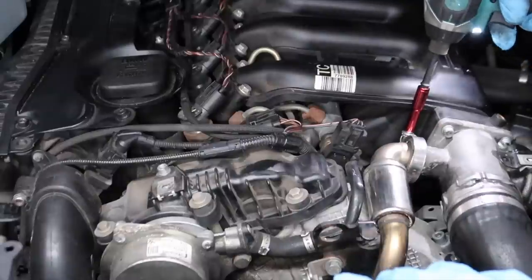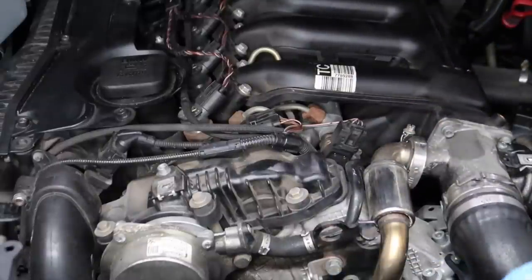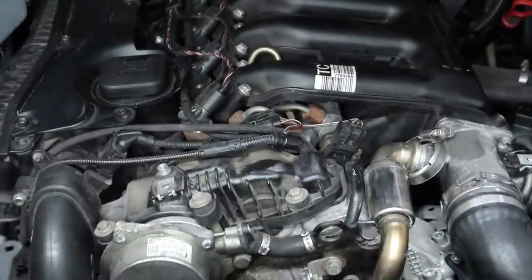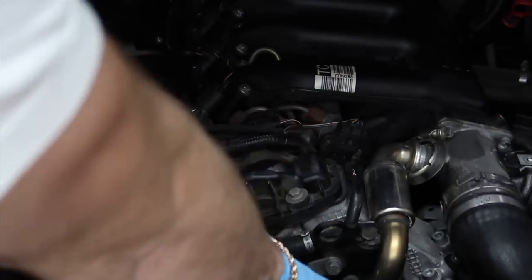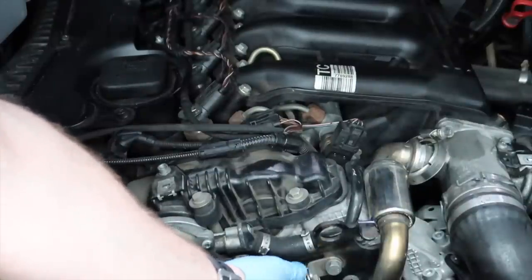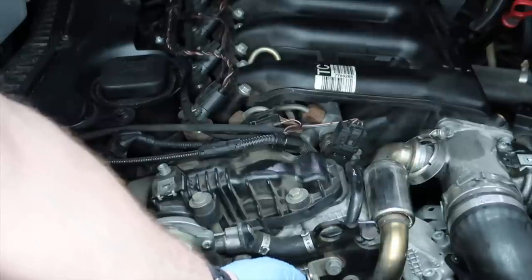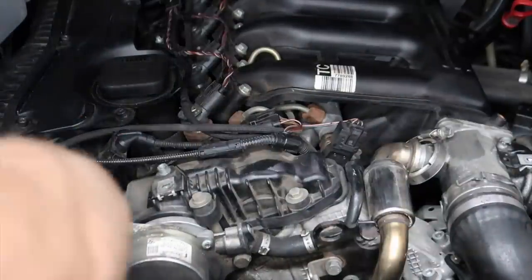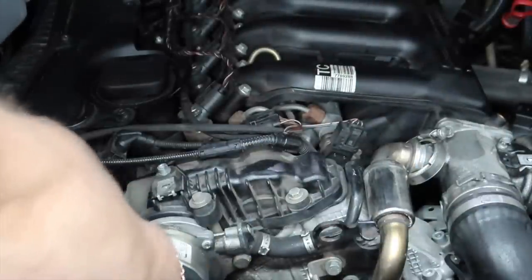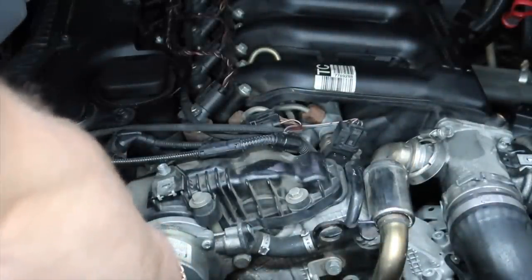We're going to release the EGR pipe locking collar to the EGR system. That's all been removed. We're going to get our 10mm socket and release the bolt right here which holds the EGR pipe on to the bracket. Now we're going to take out the turbo pipe. When you take off the turbo pipe you want to be careful with the connectors lower down — just release them as much as you can. The bolts don't come fully out so don't try to take them out completely.